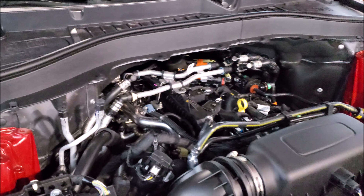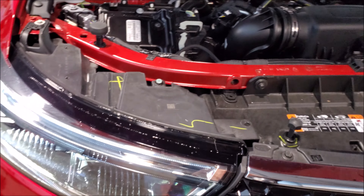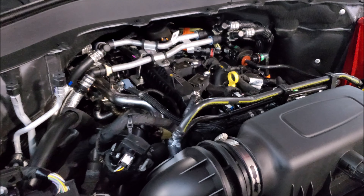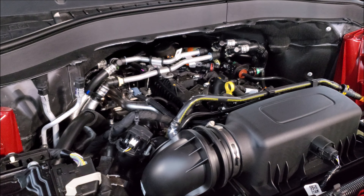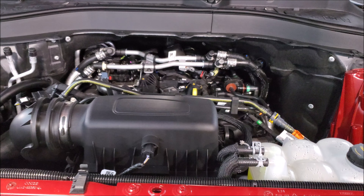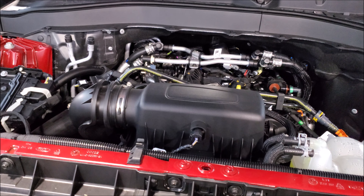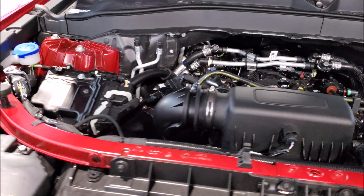Because only a civilian version was available to them, we had to convert it. You have to run all the wiring — the nice thing about interceptor versions is there's a lot of pre-wire, which we don't have here. Also, this isn't a hybrid; it's an EcoBoost and it's turbocharged. It is fairly quick, but if a vehicle is going to do a lot of idling, the hybrid is probably better for those situations. For what this vehicle is doing, it's not going to be idling a ton, so this engine is going to be just fine.